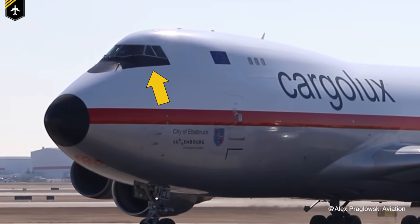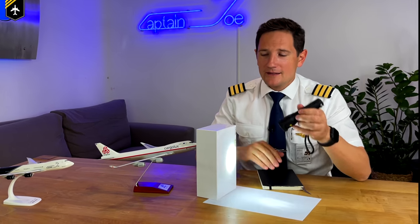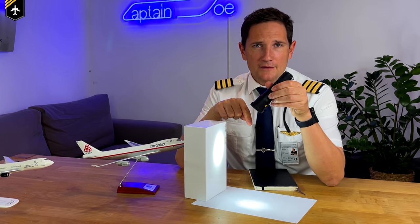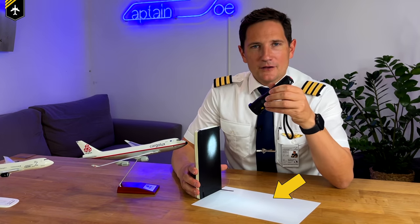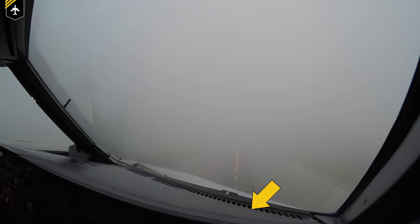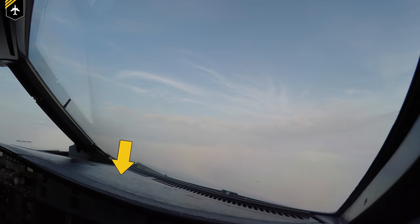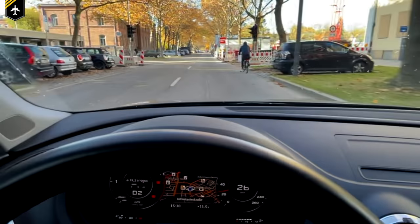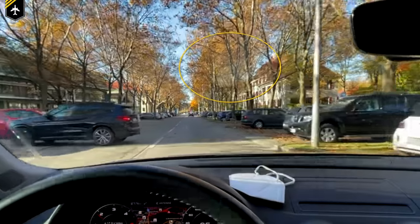You can sometimes see planes where either the nose cone or parts ahead of the windscreen are painted black. I have set up a white surface next to a black surface. Let's say my flashlight represents the sun — pointing it onto the white surface, you see a certain reflection on the white piece of paper below it. Now shining it at the black surface, there's only little to no reflection at all. These parts of the plane are painted black to reduce the glare or swallow the sunlight within the cockpit. That's the same reason dashboards on most planes are painted in black or darker colors with a matte finish — similar to the dashboard in your car. We all know how disturbing it can be when you have a ticket receipt laying on your dashboard reflecting in the windscreen.